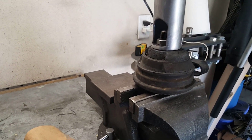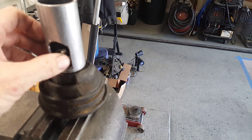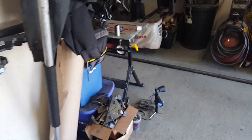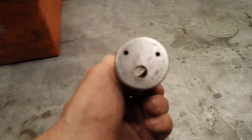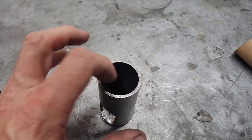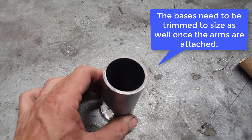We have the completed base for our E34 mounts. You can see I had to cut a window in the side so that we can get a socket on here — we can start it with our fingers and then the socket will fit over it just fine once it gets down there a little bit. The E34 mount actually has a couple of nubs that help position the rotation of this mount, so I went ahead and drilled them out. I did not want to weld or put anything in there. When I fabricate the arms, I'm probably going to thread it and put some bolts in there to hold it positioned where I need to. But once they're welded in place, they aren't going to rotate, so it's not going to be a problem — it's just for that initial placement.